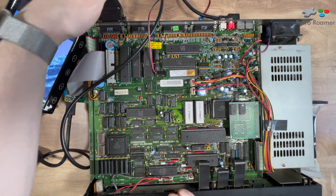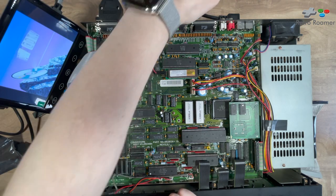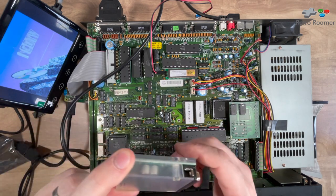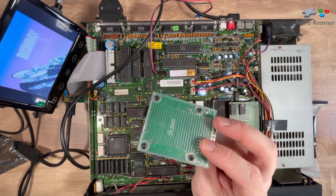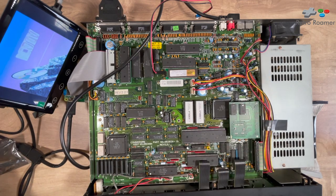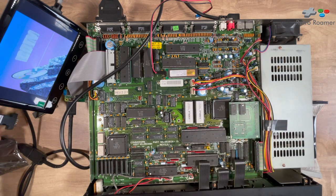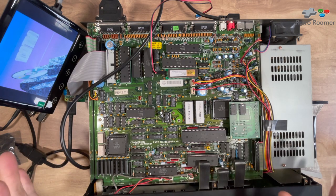So the next stage is the video card out, new one in, the blank removed and the SCSI card in, then see if he's happy to boot, which he will do, but he'll moan because that's 3.1.4, so he'll just have a right paddy that the Workbench is missing and all sorts. But it'll still try. And then, once all that is in place, we can play with peripherals to make sure that works and all the rest of them work. And then we have a nice CDTV to go in a lounge where it can be used from a distance.